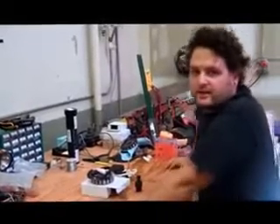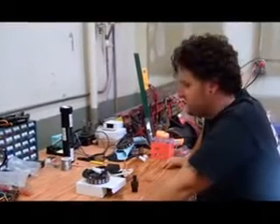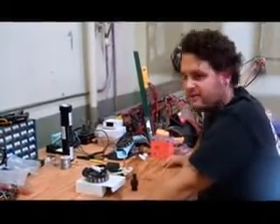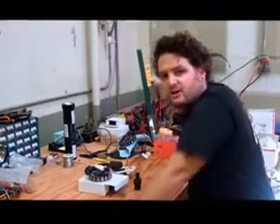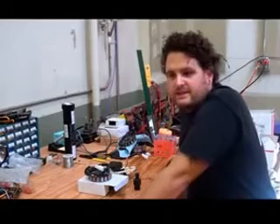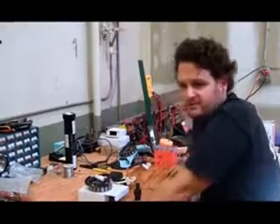Hey, I'm Evan from Racetech Electric and I'm going to show you our Yamaha Banshee DC Conversion Kit. It comes with a stator and a regulator. The stator is good for 200 watts. It will let you charge a pretty decent sized battery. You can use HIDs, LEDs, any type of lighting you want with pretty massive outputs. So you can run just about anything on the DC side of your Banshee with this kit.